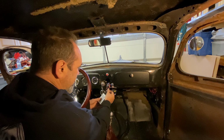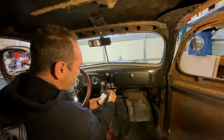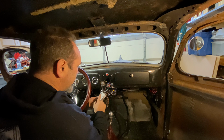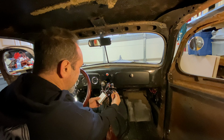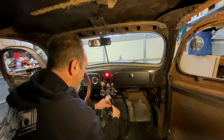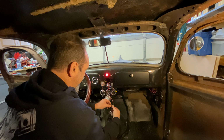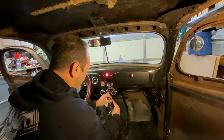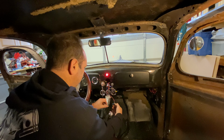So instead of having the black and the green hooked together and earthed, I've now got the green coming from the negative side of the motor, going back into the box. So the only earth in the box is this one, which is going to earth now. So let us try once more. Power on, ignition on. I don't have the light hooked up for this switch yet, so don't expect the blue light to come on, but I should hopefully have power control when I flick this switch. So far so good, no power. Oh yes. Phew, I'm glad I sorted that out.